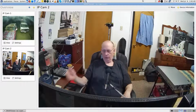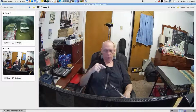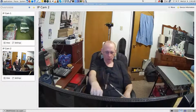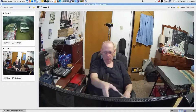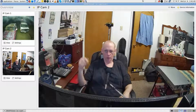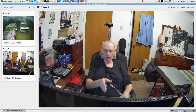that's what I want to do first. Got Fedora 32 net install in there, so I'm going to boot it up and see if it works. I've got it wired up. The VGA goes to port 4 on my KVM switch. The USB, of course, then I can control the machine with my normal mouse and keyboard. I have a 4-port KVM switch that'll switch to different machines, using the same mouse, same monitor, same keyboard. So I switch over there, and I'll see it booting up on the VGA.